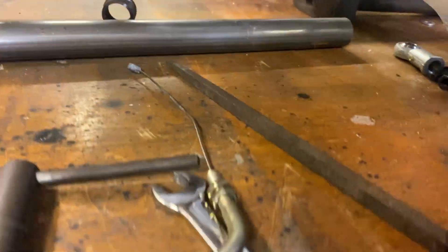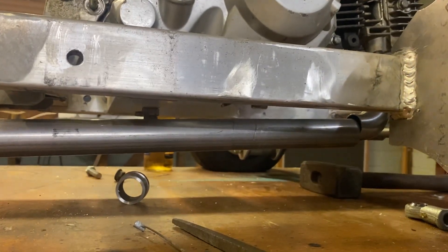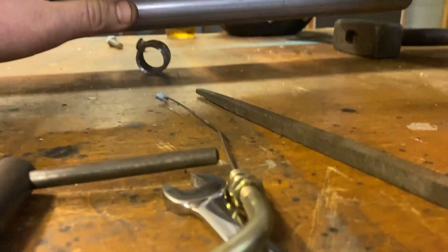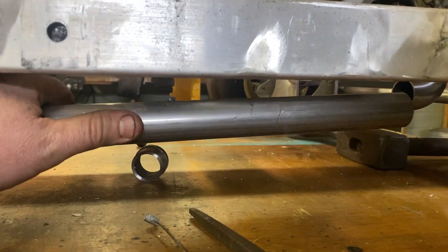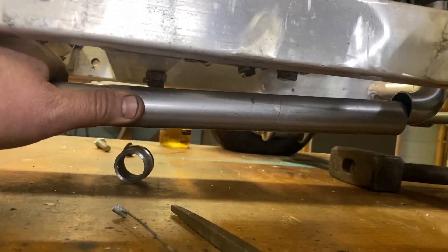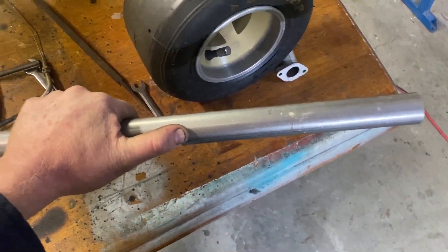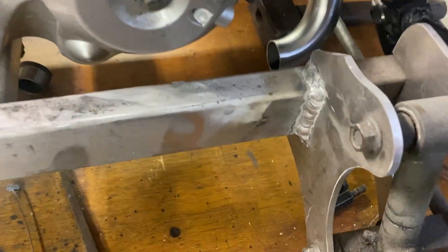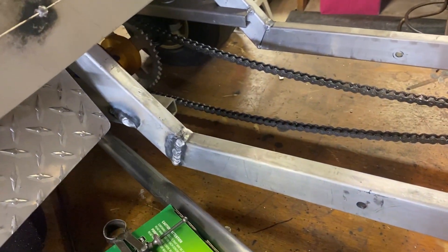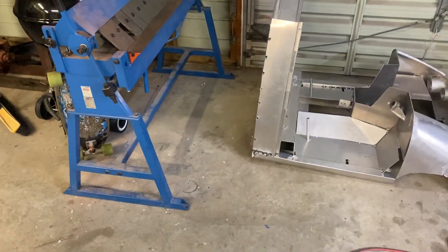What we're going to need to do is not use tapes — we'll use the backyard way. There's the cross member about there, so center — yeah, sweet, that's where we are. We're going to make a cut there and TIG weld it up there. We'll be running on sort of a taper down to the center of that cross member, and then taper back up to the back there. I could get all fancy with pipe benders but yeah, it's not how we do it around here.